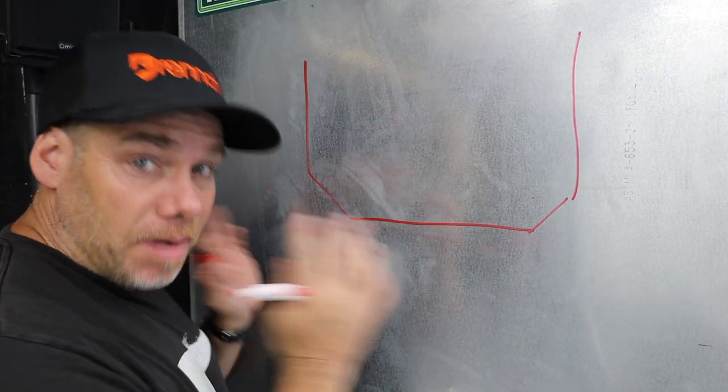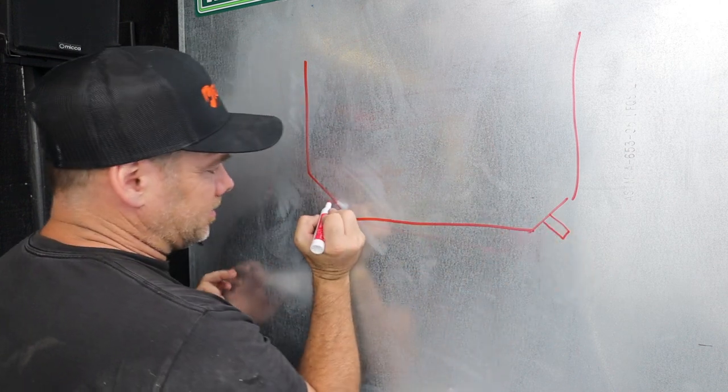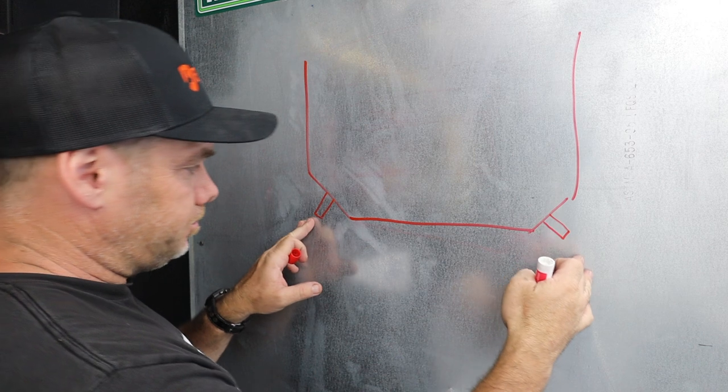So I've had a bit of a think between when you last saw me and now, after I've gotten this thing off the cart. What I need is a way to lift the engine where it's always level as I lift it. I have a parallelogram jack, meaning a jack that has a platform that goes up. If I can make a cradle that will bolt to the engine mounts and that cradle is level, I can use my jack, which is also level, to lift the entire unit up and it will stay where it's supposed to stay. Okay, if this is the bottom of the Subaru engine, the engine mounts are sort of like this. They're at this weird angle.